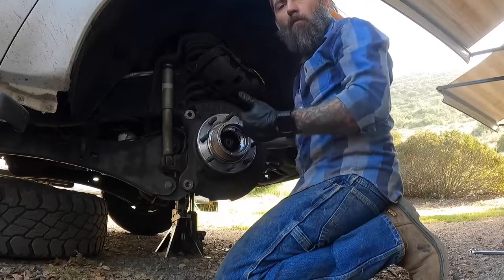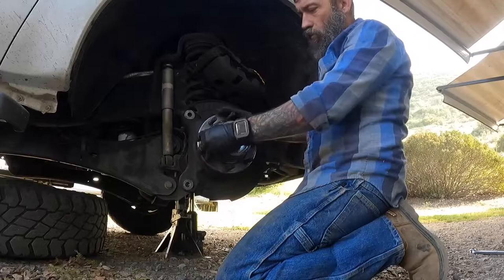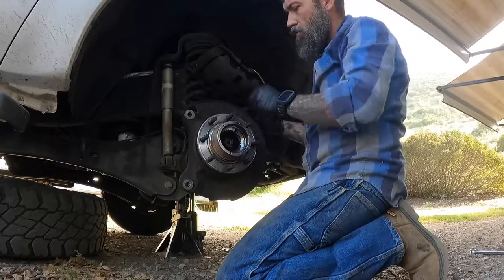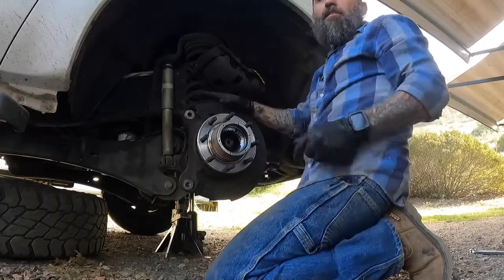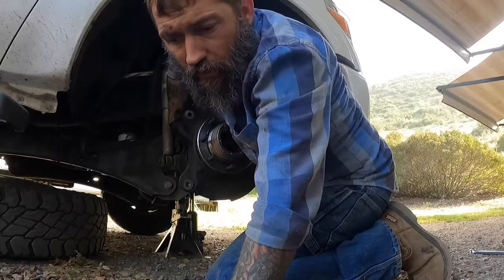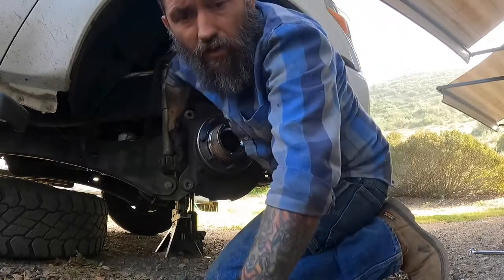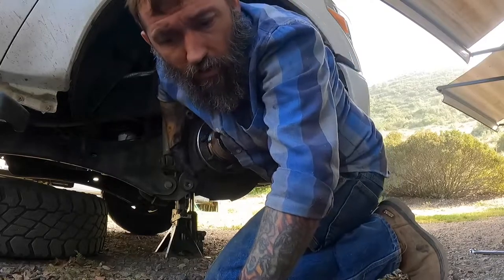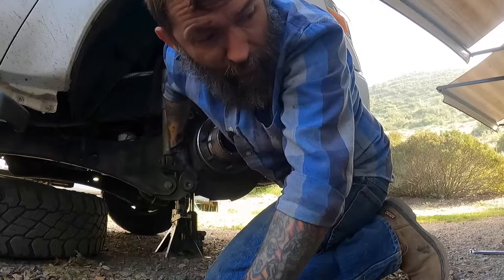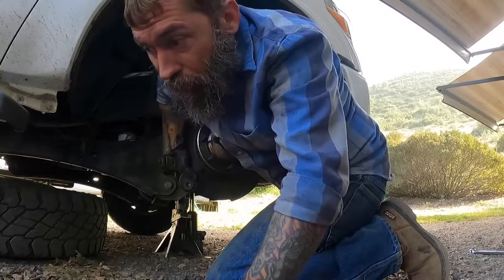The big problem you have with parts on your wheel assemblies, your rotors, your lug nuts, your hubs, all of this to your ball joints, your tie rod ends, is they like to seize themselves on there, especially in like East Coast vehicles where there's a lot of rust and stuff. So getting your hub out of the knuckle could be a big problem for some people. I don't anticipate it being much of a problem for me, but it's something you gotta watch out for.